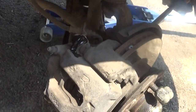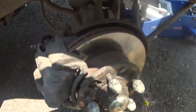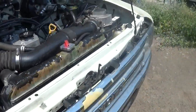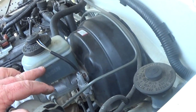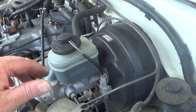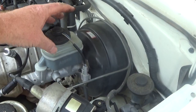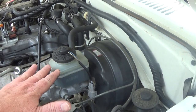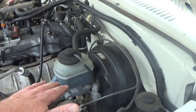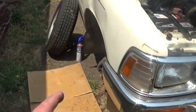I'm liking this squirt bottle — don't have to deal with running out of aerosol. Let that soak in. While I'm waiting, I've already popped the hood and I can see my brake reservoir — it's not above the max, but I did one side already and it's lifted the level up a little bit. What you want to do is crack that loose — keep it on there so bugs don't fly in or anything — but you want it open so that when I push in my brake calipers, it'll lift the fluid level in there and then hopefully go back down when you're done.